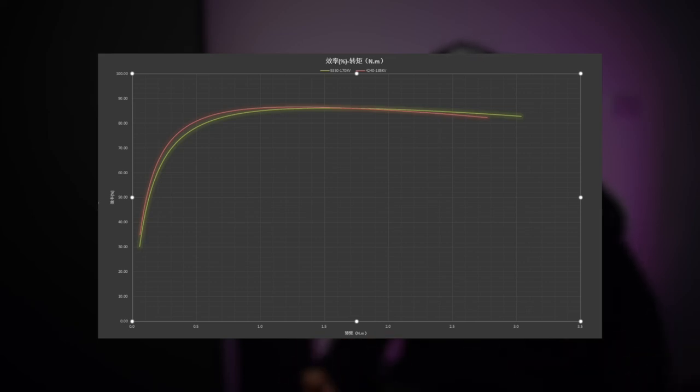You can see that the difference is negligible, and that's because Exway measure the stator size from the inside of the motor, and my DIY friends tell me that's how it should be measured. Whereas other brands, such as Evolve, include the outside can in the measurement too.